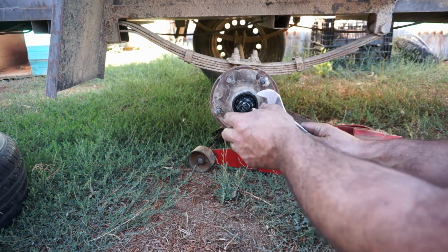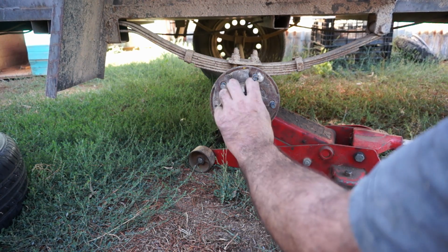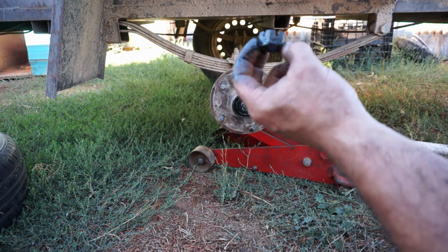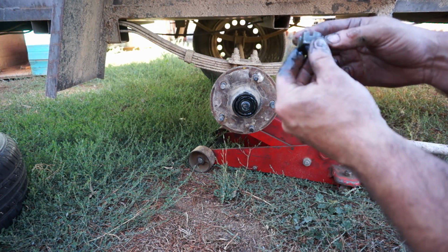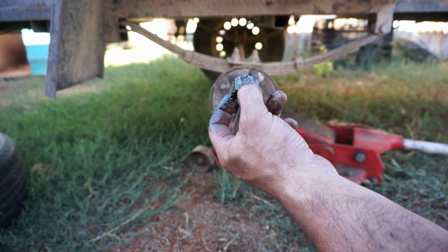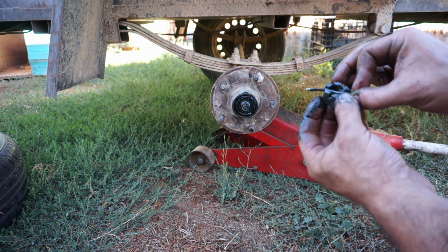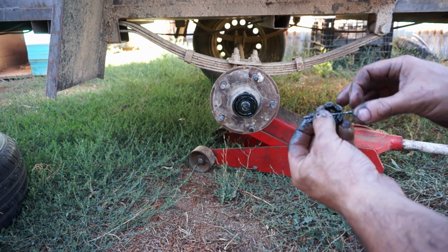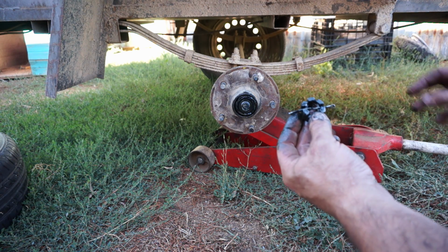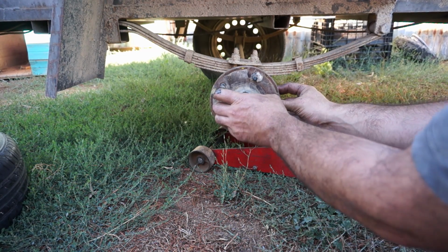And we'll just take this nut off so I can show you what's going on. So you'll see this nut has little cutouts in it, so it looks a bit like a castle from the olden days, which is how the nut gets its name. And obviously the idea of those cutouts is so the split pin can go through and stop the nut from undoing. So even if you don't do up your nut tight enough, it can't undo itself, so there's no risk of your nut becoming undone and the wheel falling off. Now behind the nut there'll be a washer, and every trailer I've ever seen has a washer.